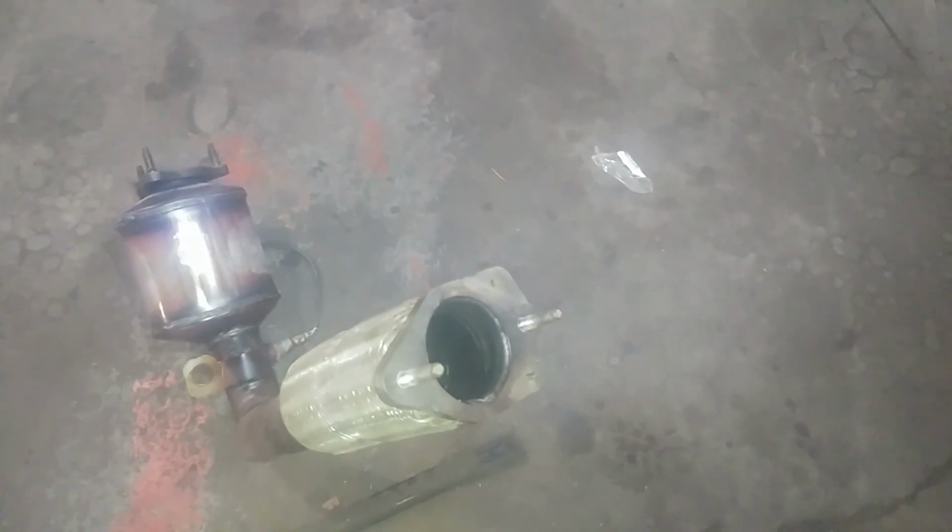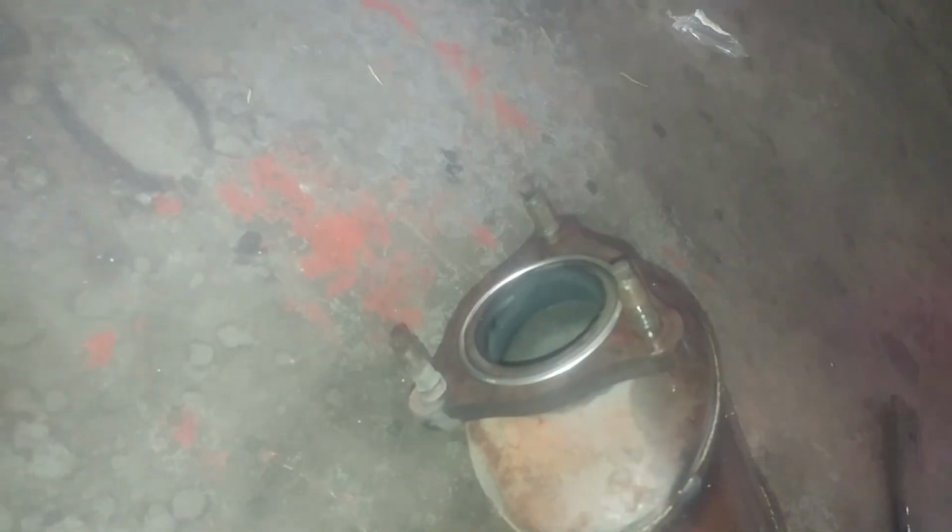So you want to consider getting new exhaust gaskets. These ones can kind of be reused, I feel. These metal crush ones may be less likely, not as good to reuse. And that goes right up in here. So I'll throw new gaskets up there and then bolt it in place. I think these nuts are 37 foot-pounds, and I think these are also 37 foot-pounds. If not, you'll hear about it.